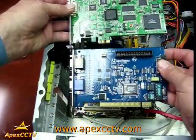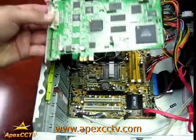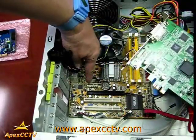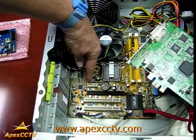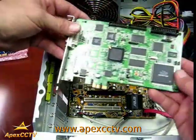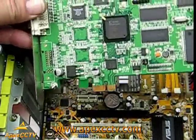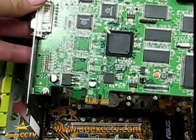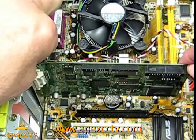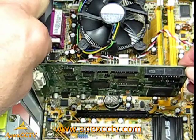This is PCI on this one right here. The only difference is that on the PCI Express card you must have a PCI Express slot for it to fit in, such as this PCI Express 1 slot right here or the PCI Express 16. Once again, all you need to do is take the card in your fingers, go into the slot, and it goes right down inside and you push it until it locks in place.